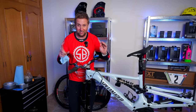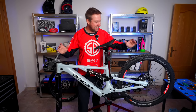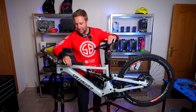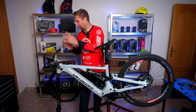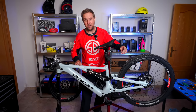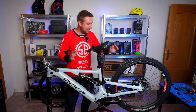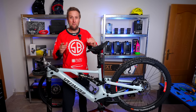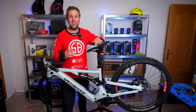The first thing you want to do is pull the brakes — but put the wheel in first. We have the back brake installed, and let's test it: oh yeah, we've got some stopping power! The brake lever is almost at the bar, so we are going to need to do a bleed — I'll cover that in a couple of videos time. For the front brakes, it's pretty much exactly the same but easier because we don't need to do internal cabling. Make sure the cable comes on the inside and goes through the little cable holder. Riders, we are almost there — next week we're doing running gear, dropper, and something special, and then the bike will be done. Thank you so much for your support; if you haven't entered the competition please do so, smash that subscribe button, hit the like button. Stay safe out there and we'll see you next week.